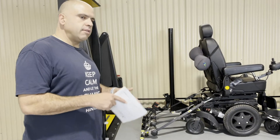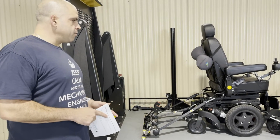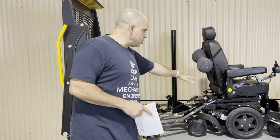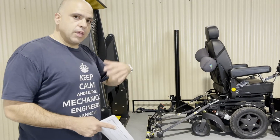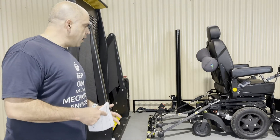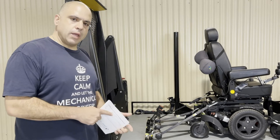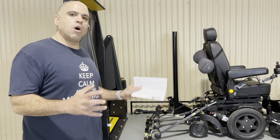You do need six if the manufacturer's instructions require it. Sometimes, because the chair has a heavier seat back or something heavier on the top, they'll also need to have tie-downs for that top section, as you can see here. So if there are six tie-down points and the instructions say you have to use six, that's basically what you have to do. People might ask: why do we have to use six when we didn't have to before? It's because of the technology going into wheelchairs these days — the batteries required and the infrastructure needed to hold it all together.